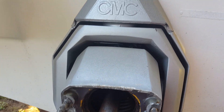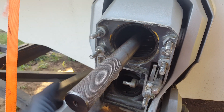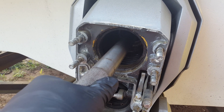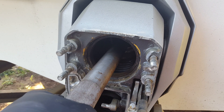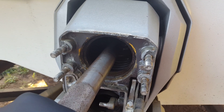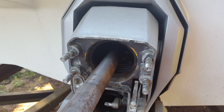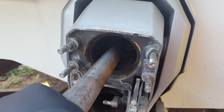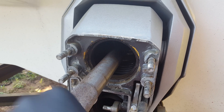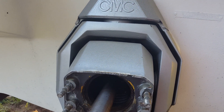You will definitely need a second person for this. You're in the boat adjusting the engine mounts and you need someone on the outside to tell you whether the alignment is getting better or not. If you're jumping in and out of the boat yourself, you'll be there all day and never find that sweet spot. Have them turn the alignment tool and tell you when there's zero resistance.